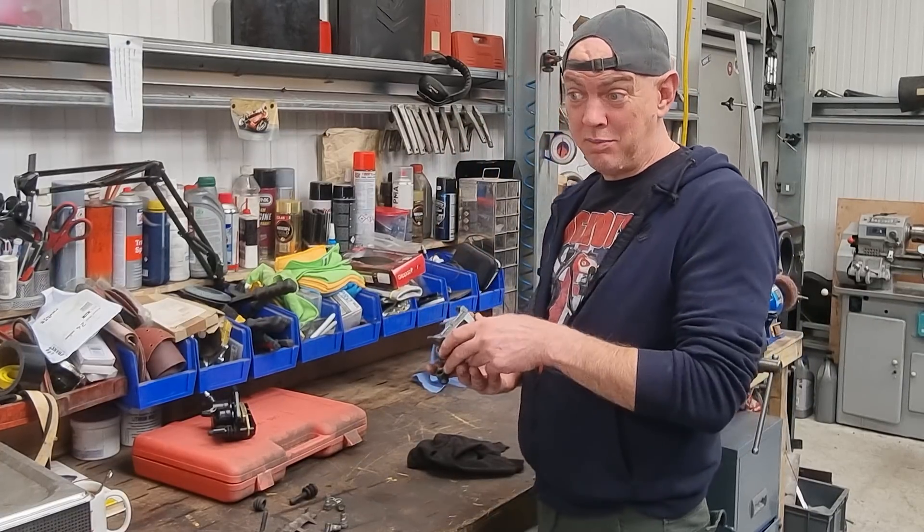So this is apparently quite the common upgrade. I've got the calipers all built up, so that's all fine. First thing is that hole is for an M10 and these are an M8. So I'm going to want to put some sort of sleeve in there just to try and take up the gap. But also when these are on the disc and hard up against that mating surface, the caliper is slightly offset - it wants a couple of mil, I want to move it like that.